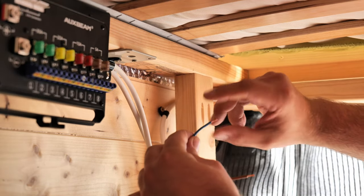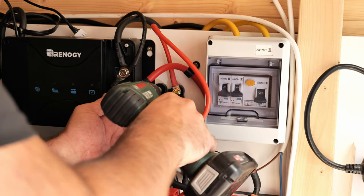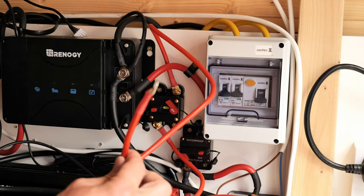I just don't want to add more wires or extend anything. I'm hoping that everything right here in the box will be sufficient. I'm not going to connect it to the van's starter battery — I'm going to connect it to my leisure battery. I really like the way they thought of everything, because these terminals are M8, and most batteries are M8, and this is M6 to fit the controller exactly. Unfortunately I did have to extend the wires, as they come down from the roof to this post right here, where it becomes a T-junction. You've got a pair of cables going up front to the controls, wires coming up, and wires that have to go to the power source.